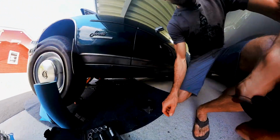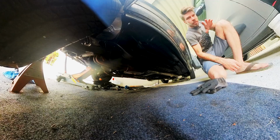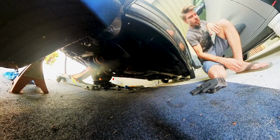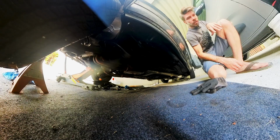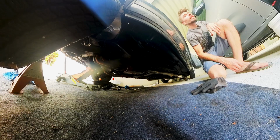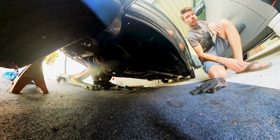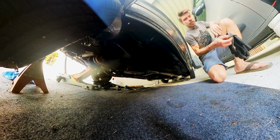And yeah, maybe the connection is just bad. What I know so far is that with the purple wire, the drain got higher. The brown wire didn't add a thing. So I gotta track down the purple wire. And this one goes to the EFI harness. So maybe something's up there. Let's bolt the starter in and inspect the fuel injection harness.